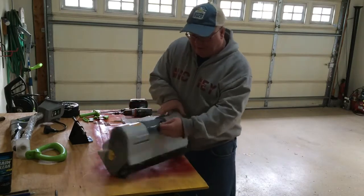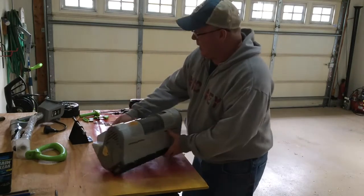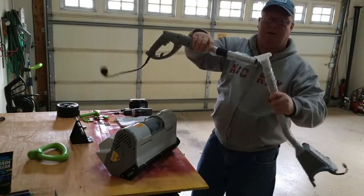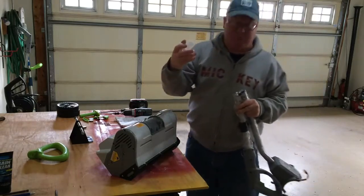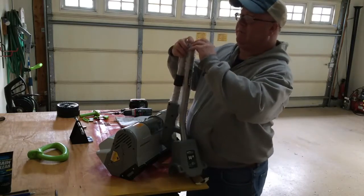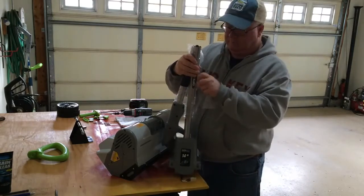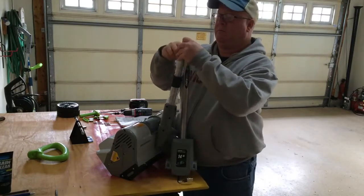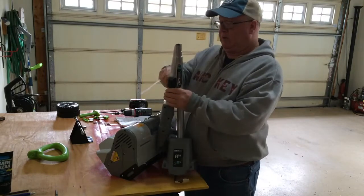We're going to take this rubber grommet off that's right here. It's covering the plug. That is where your plug for the upper part of your handle is going to go. Now, this white cover, you can disregard this, throw that away. That's screw. Take the plastic off. Get rid of all of this before we even start, so it's not in the way.